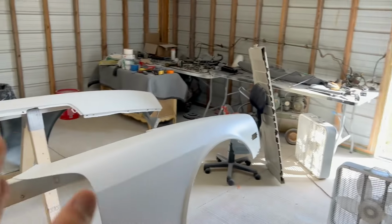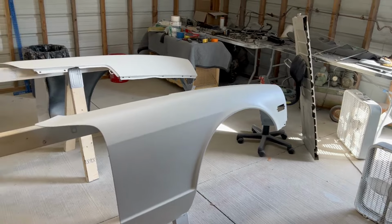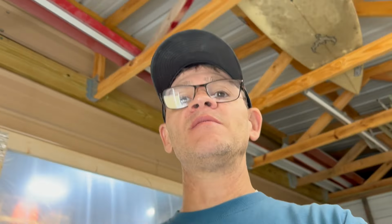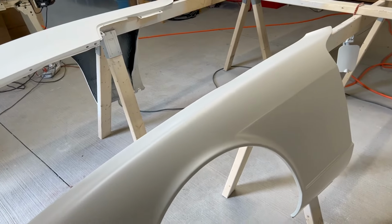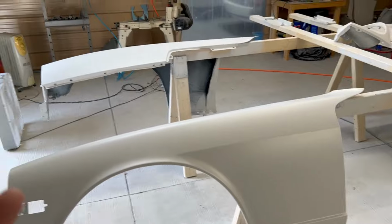So the first one is not really a dusting, but you're not putting it on very heavy. The second one is a wetter coat, and the third one is a wetter coat. But 15 minutes minimum between coats. And you got to use slow hardener. Those are the only two things I'm going to really tell you guys that, in my opinion, are the most important. If you want to get rid of that solvent pop, that's what you got to do. And you want to paint in a relatively normal temperature, 75, 80 degrees.